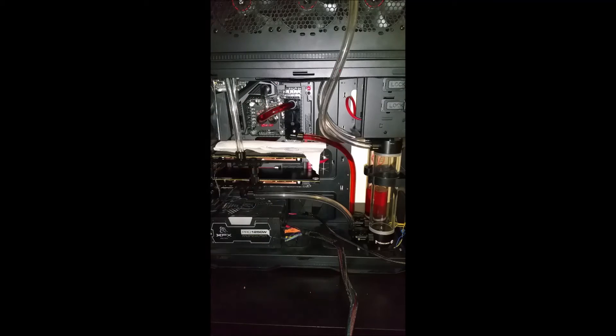The pump's on and you can see it's still coming right back — we didn't hit the flow point we wanted. The level is a little bit higher in the tube so we can put more liquid in. Go ahead and switch the pump back on and you can see now that we have a continuous flow through the loop. The water's flowing all the way down through the radiator and back down into it. We want to fill it close to the top so the pump will suck in clear water instead of anything with bubbles in it.